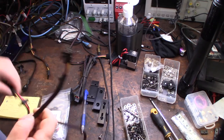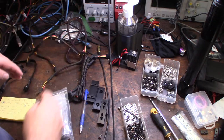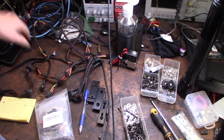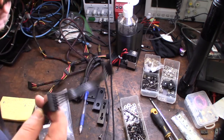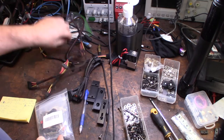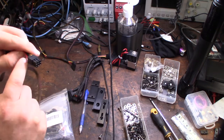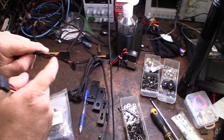It's pretty much the same connector they use in pretty much every ATX Power Supply — for 6-pin, 8-pin, or the 24-pin. My problem is I'm actually burning cables on my Corsair Power Supply. They used the wrong size gauge for the cable. So I have some existing 6-pin cables that actually have a heavier gauge wire, and I'm hoping I'm not going to burn these. But I've got to re-pin these for Corsair — pull out the connectors and rearrange the wires.